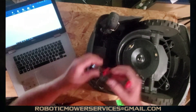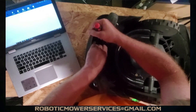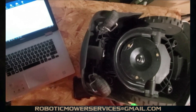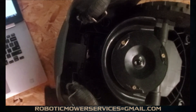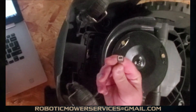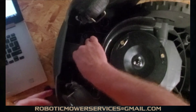A little easier to do with a screwdriver. There we go. So now, in here where the battery is at — it's kind of hard to see — but directly here in the front, there is a port right there that you would find on the back end underneath on the majority of the AutoMowers, like the 300 series and the 400 series, minus the 435X. And that is where you connect the USB cable to this 115H. Just plug that in there.